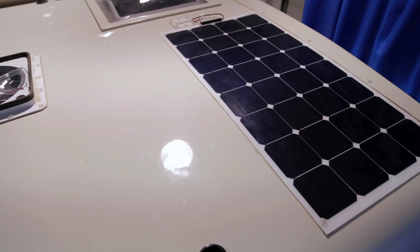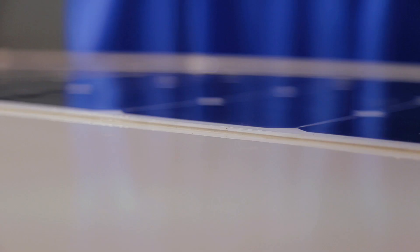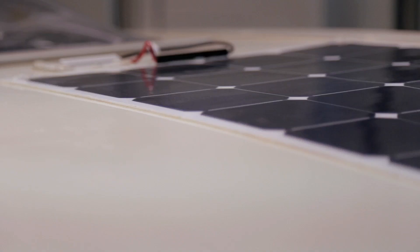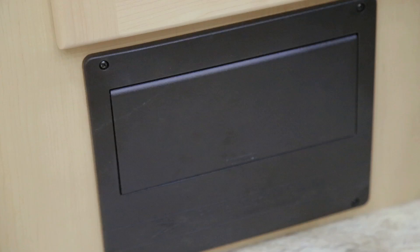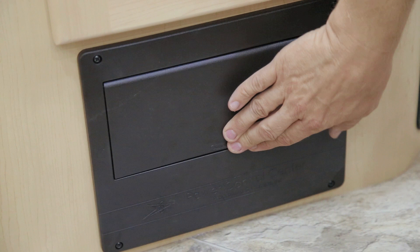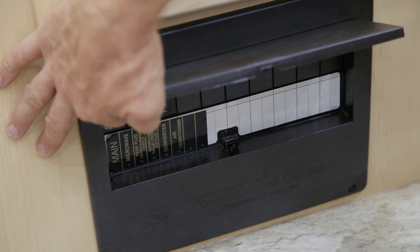The solar panel on your Plateau XL is a flexible solar panel — keep it clean for best energy absorption. It is 80% lighter than a normal glass panel and is mounted directly to your roof, providing no wind resistance. Situated below your television and DVD player cabinet, you will find your 110 breakers controlling all 110 power in your coach — breakers for your main, microwave, rear plug and entertainment center, bathroom and fridge GFI plug, converter, and air conditioner.